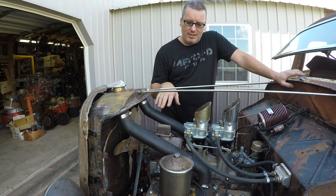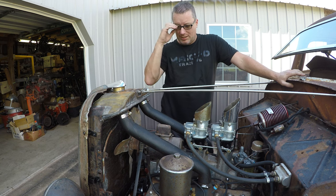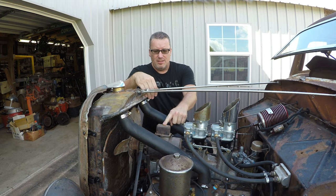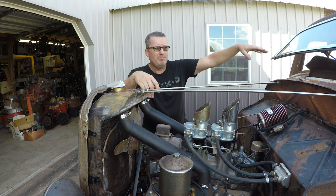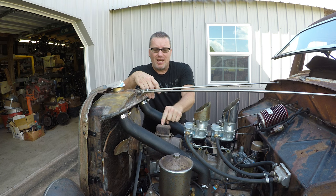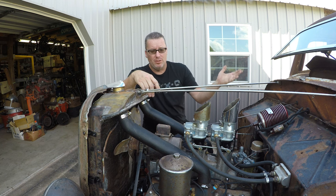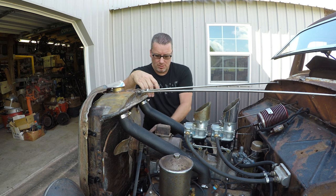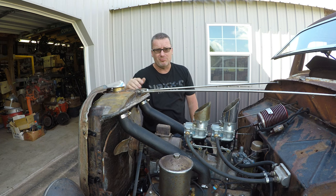The cutout — most people don't even realize what it does. It cuts it out. That's exactly what it does. There's no magic smoke inside, although you probably can let the magic smoke out and never get it back in. All it does is when the motor fires up and the generator starts spinning, it makes a contact which allows the juice coming from the generator to go back to the battery. Then when it turns off, it releases and opens up, doesn't make contact anymore, and that keeps your battery from discharging — because it will discharge if that sticks and holds closed. It's just like points in your distributor — it's got two little discs that come down and touch each other, and you can clean and sand them just like points.